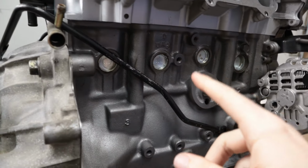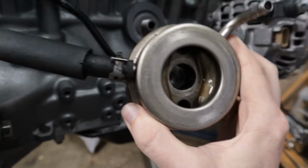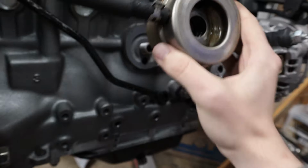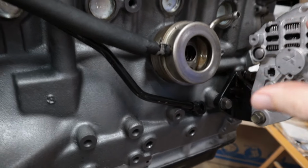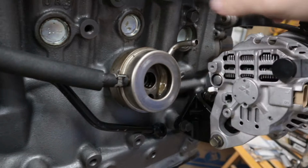But the turbo is not the only component that needs coolant, because the Mazdaspeed Protege also used an oil cooler. Now, this is an oil-to-water heat exchanger rather than an air-to-oil heat exchanger, and so it uses a coolant line. So this goes right here, like a little sandwich plate where the oil filter goes, and then, of course, you use a longer stud, but the oil filter still goes right here, but there's a nipple here that gets the water feed from this same jacket.